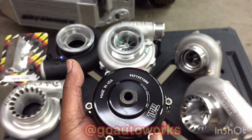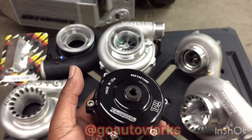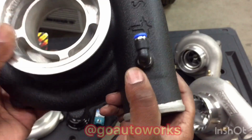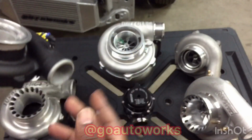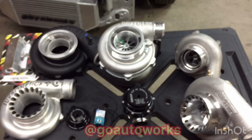And a great part about doing a vacuum manifold is you can match up the air fitting size, whether you're using a barb or a push lock fitting like I have here. You can match them up so that you're not trying to reduce or go up or down in vacuum hose size trying to make something work. And that's what you get into when you're trying to do T's. You're trying to mix and match vacuum IDs, or interior diameter of the vacuum hose, in spots that you typically shouldn't have to. So if you put a vacuum manifold on the car, you can run that straight hose to the vacuum block and not worry about any T's or mixed-match hose sizes.